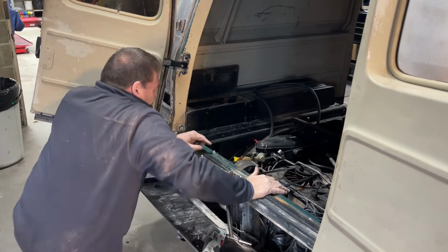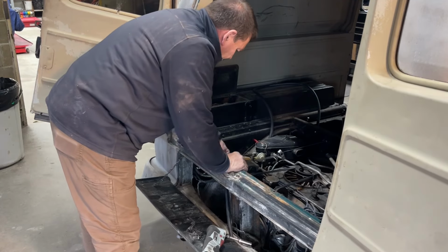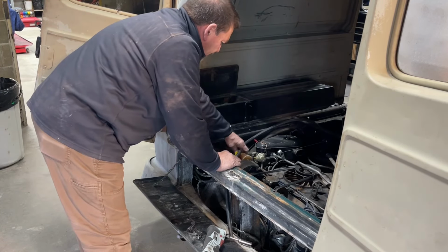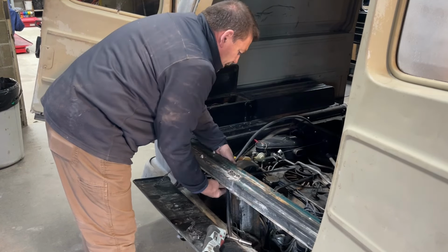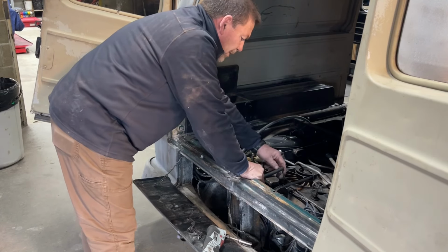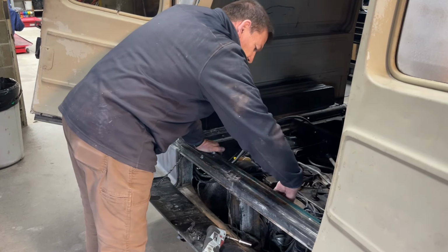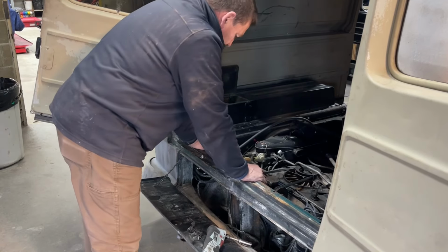I may change out the hardware that I just put in there, but you get the idea of what I'm doing. So this will hook right here where the filter's at. So I'll cut that a little long, and then this line hooks where I had it originally hooked, at that T to feed the carburetors. So I may zip tie that up there or something just to kind of hold it out of the way and stick this one down in that cavity.